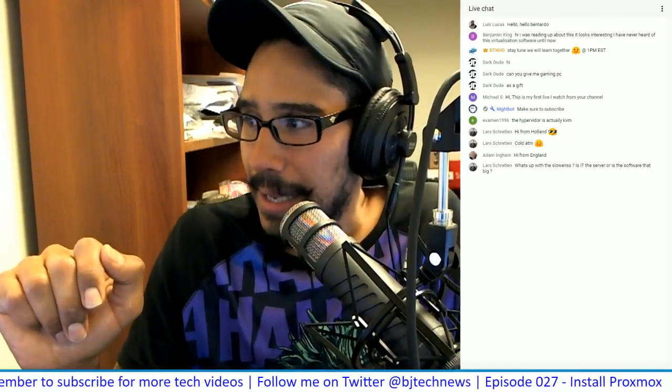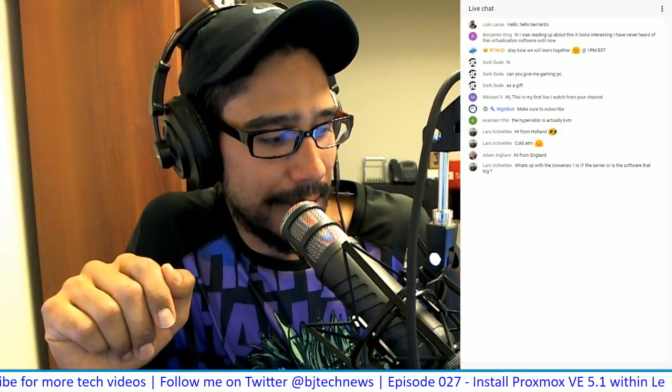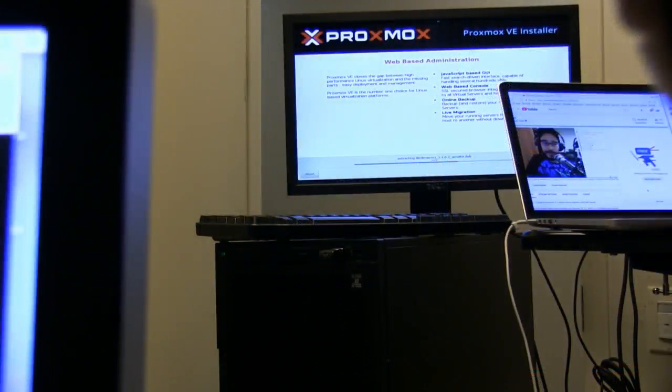Well, okay, that's a good question. Is it the server or the software? It's not the server. I think it's because I plugged the USB flash drive into a 2.0 USB port. You have to understand, the speed of a 2.0 USB port is really slow. It's the flash drive, inserted into a 2.0 USB port, so it's going to be a little sluggish.